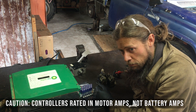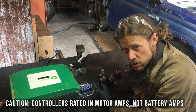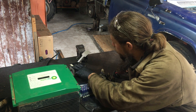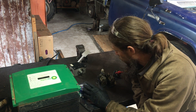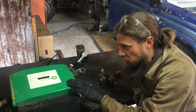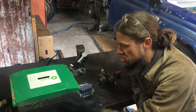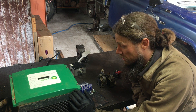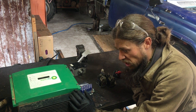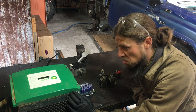Our batteries can only do 140-amp continuous anyway, so we'll move around — we just might not go up as steep hills yet. Pot box for the accelerator — that's got to plug into the motor controller. I want to see if this old inverter, which could be fixed, can be used as a box for our motor controller and shunts, and maybe we could put the BMV on the outside and it could be really nice. Let's give it a go — let's open it up and see.